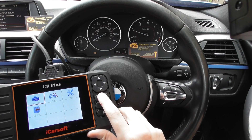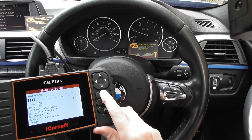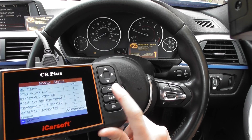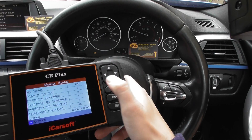So I'm just going to go into the OBD2 eOBD option, which is a really simple option to go into. And what it's going to do, it's going to find a connection with the vehicle. It's telling us that there were two codes and the MIL status is on.